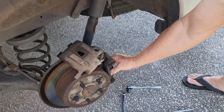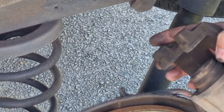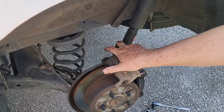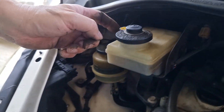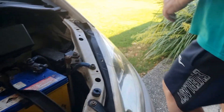Now, because there's so much extra pad there, we're going to have to push this piston back in. Make sure before you do that — I'll come up front and show you — make sure the brake fluid reservoir is at the low level. Because when you push that piston in, it's going to raise the level up here and you don't want it overflowing. So I'll go back and push this piston in.